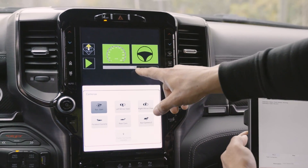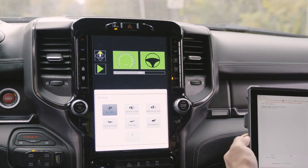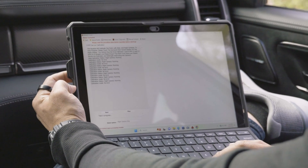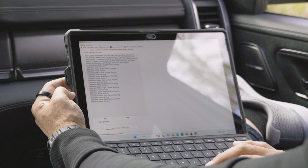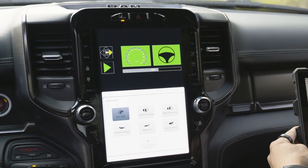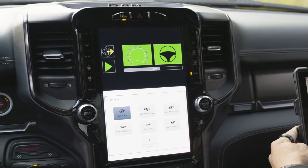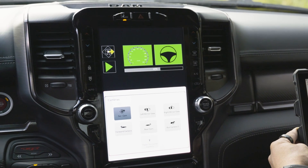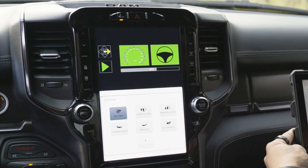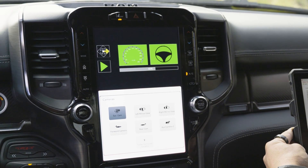Let off the brake — don't press the gas — and it'll go green. Then you just wait for the scroll bar to hit a hundred. You can see our display in Alpha is continually scrolling with no error, test in progress. We're basically just going to roll until we get a successful calibration on that camera. This would be beneficial if you're doing this with a buddy, so one of you can handle the programming side while the other drives.